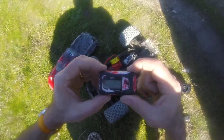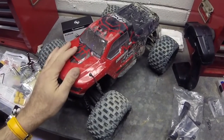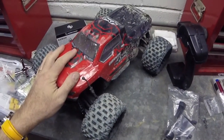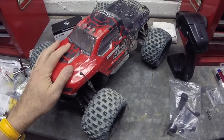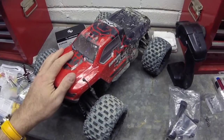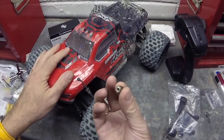With the NiMH I got 24-25 miles an hour. The Arrma Granite 4x4 does say 30 mph plus on the box, but you need the optional 27-tooth pinion just to reach the peak speed we got today of 24-25 mph. Not saying this car can't hit 30, but I couldn't get it to do so in these couple of tests.